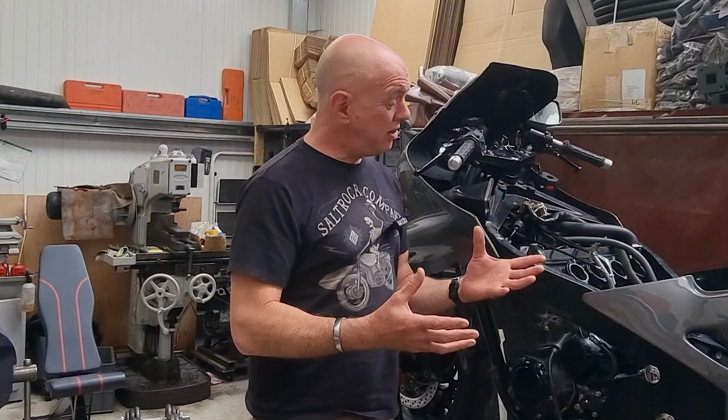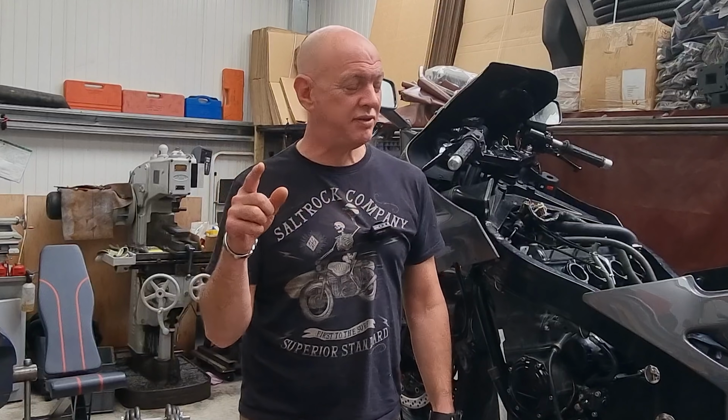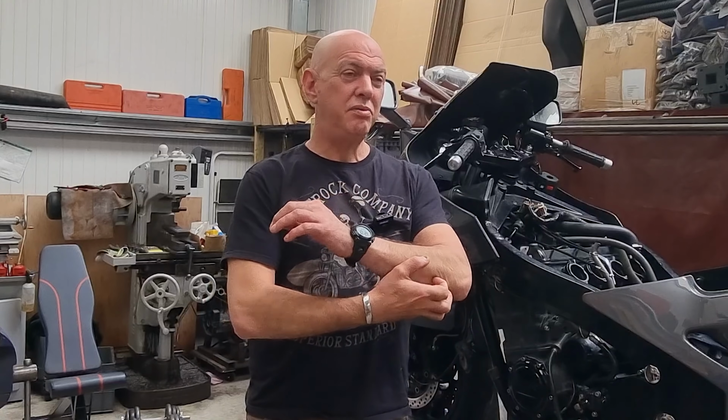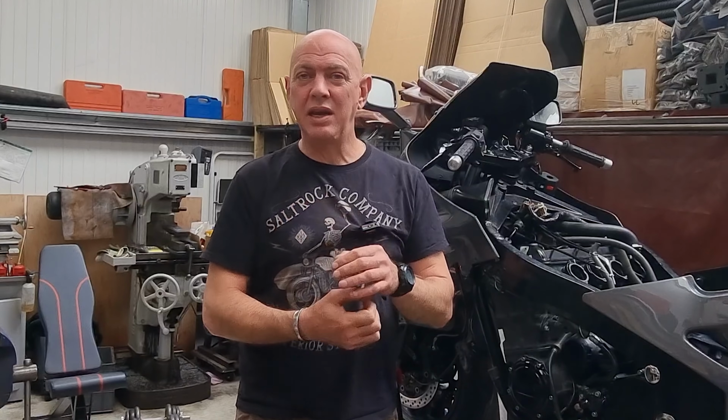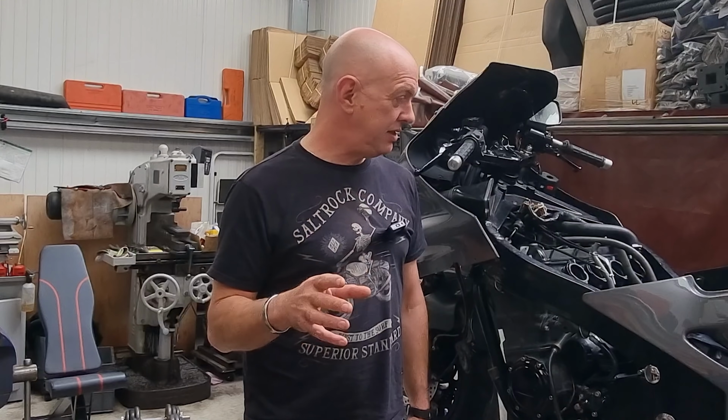We know it's going to need to change anyway, and the carbs are off, so I might as well do it now. It's not going to hurt. We're still going to stick it on a dyno and see what we can get out of it and what the AFR curve says. But, you know, I might as well. Bits ain't going to be turning up until next week, so it's not like they're going to be going back on again tomorrow. So I might as well see if I can get some. And the carbs will go on when the jets get changed.